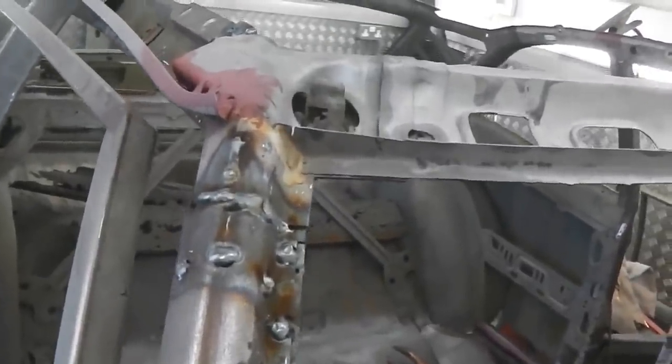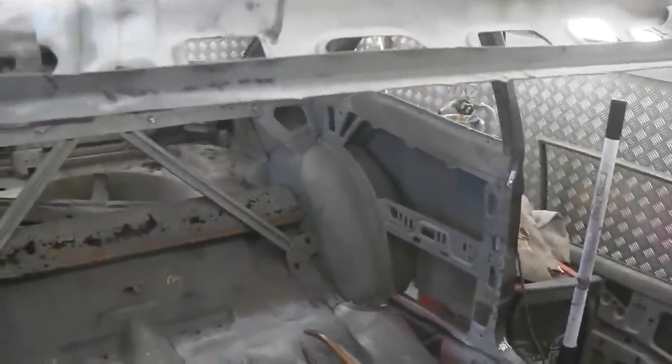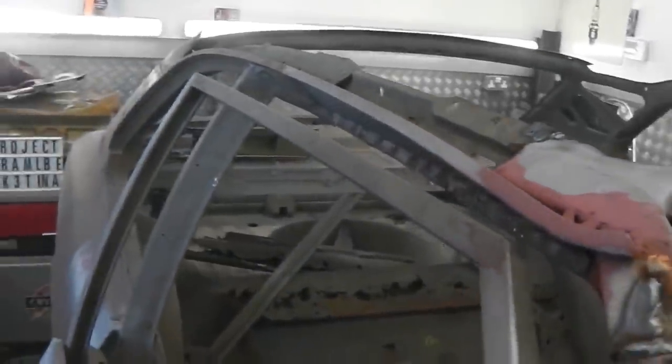Got to unpick the rest of the skin off the back and the front. Here's the rest of the skin to unpick. It's again crocky sander along the front to get rid of the remains of that. And then there's a little bit of quarter wing. No quarter wing left, just quarter staying on. Just the remains of the roof where it meets the quarter. So we'll be attacking those welds there on the fillet plate. And then down that run, pretty straightforward really.